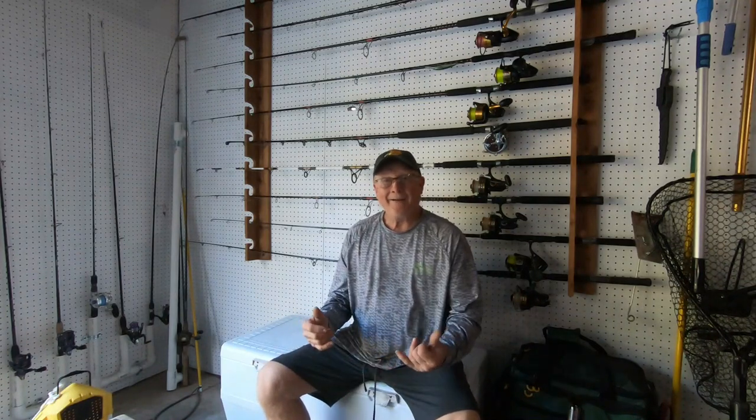But when I went to back up, the wheels locked up on the trailer. So here I am in the street, I can't back up, and I'm like, what the heck's going on? I have surge brakes on the trailer because I have a dual axle trailer of a weight class where you're supposed to have the brakes by law. Every time I went to back up, the wheels were locking up.